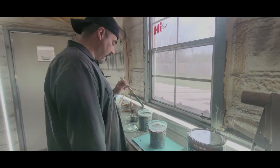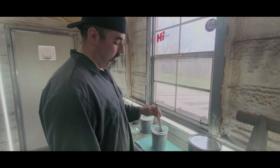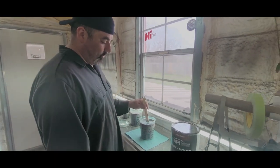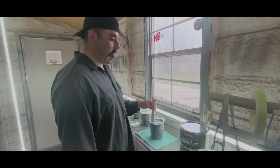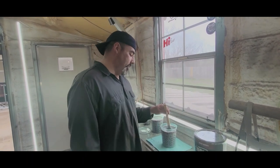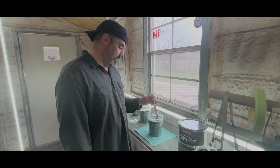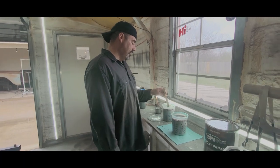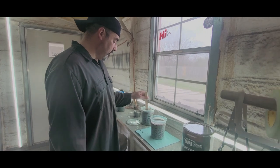So this epoxy, I talk about it on the channel all the time. I like it because it's sandable. It has a 7-day open window, so we can spray it today, and if I had the Raptor, we can Raptor it like tomorrow or within 48 hours or so. And you don't have to sand nothing. You don't even got to touch it. And that chemical bond is not ever going to let loose. So that's why I like it. It's affordable. The gallon kit used to be like 200. It might be like 240 now. Went up a little bit. So did everything else.